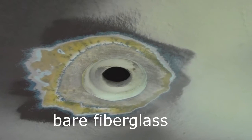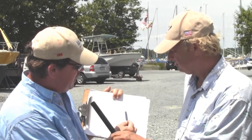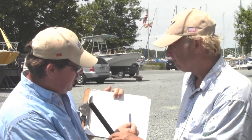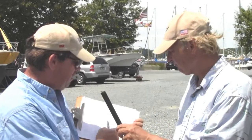What you don't want is any voids in there, because that'll be a way for water to get in and start working its way through the rest of the bottom. Make sure you lay layers, let it set up, then lay a couple more — two or three layers at a time — and work your way all the way down to the actual outside bottom. When sanding, you don't just want to get the bottom paint off — you want to get right down to the fiberglass, take off the gel coat and barrier coat, start fresh with the glass, and build it back up to match the rest of the bottom.